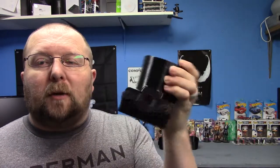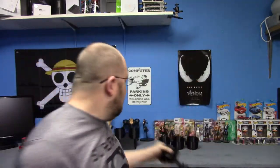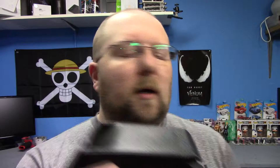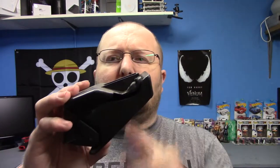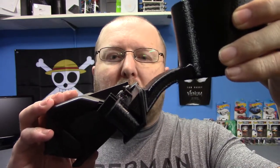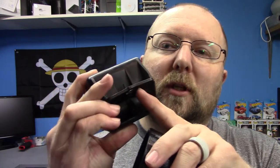One update I wanted to let you guys know on a prototype. I have been working on the coin holder replacement one. It's going to use the same or a very, very close version of this. I've got to check some of the mounting locations and stuff, but it looks like the holes will line up the same. I have a couple little tweaks I want to do on this, and I'll explain that here. So my plan is I took the cup holder and mirrored it. So you've got your coin holder, and it mounts in the car about like so. The cup holder mounts, you know, about the same area. So all I basically have to do is go from about here down to this other mount hole here.